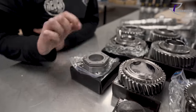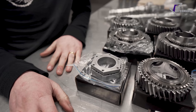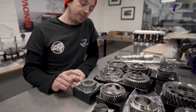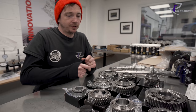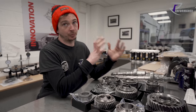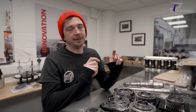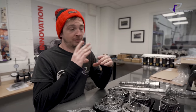On the 156 trans the pinion is two nuts — you shim the bearings and then do the nuts up to torque, and that's how you set the preload on the bearing. On the DCTs it's like a big spring washer, but it really isn't — it's more like a massive sleeve with a bellows in it, and you have to crush it down and that's what sets the preload.